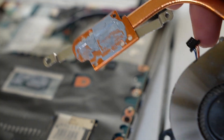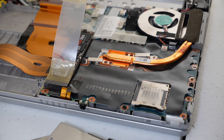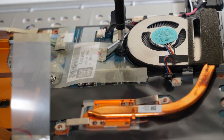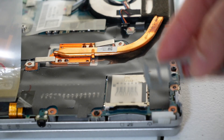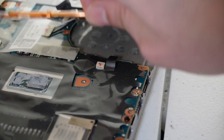What isn't shown in the video is removing the heatsink and fan. Before beginning, make sure the fan is unplugged and the NVMe SSD is uninstalled. After that, it is just removing a few screws and a piece of plastic. Overall, the process is pretty straightforward, and for the plastic, I would just be careful and take your time.